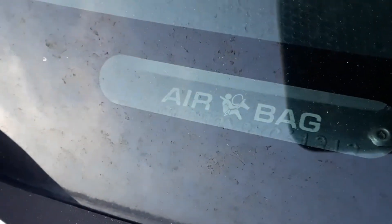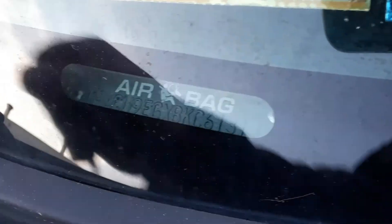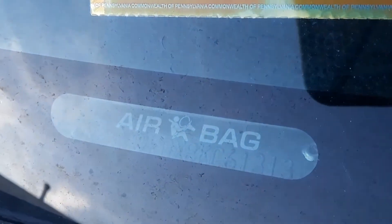But if you cannot find this tag — because sometimes the doors were replaced — you can look at the owner's manual or title, or check the front windshield to get the VIN number. You can call the dealer's parts department and they'll give you the paint code based upon the VIN.